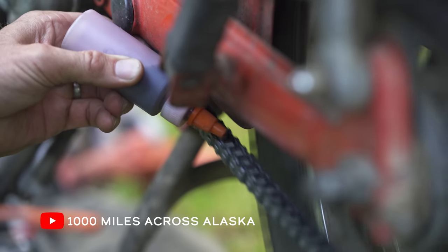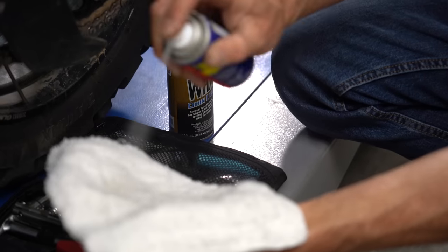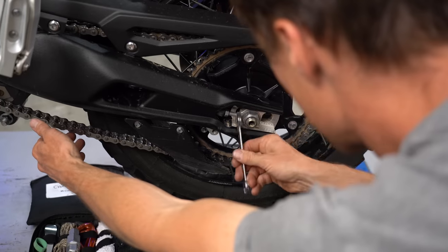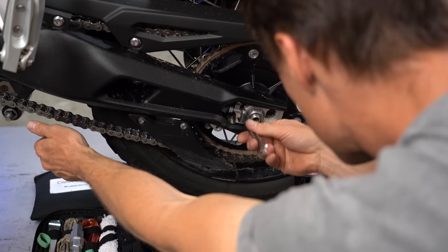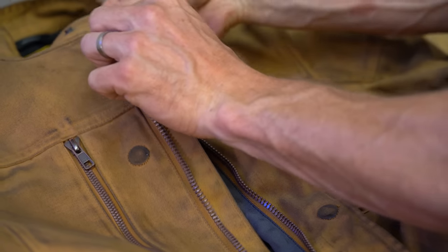If your bike has a drive shaft, good for you — you can skip this section. For the rest of you running a chain and sprockets, those parts will require some attention during an extended trip. I generally give the chain some TLC at the end of every day of a road trip, since it's easier to wipe off a little grime every day than to scrub off a ton of grime once a week. I just mist a rag with WD-40, use it to wipe down the chain, and then apply a little bit of lube. With modern o-ring chains, the most critical lube is already sealed inside the links. If I'm running a clip-type master link instead of a rivet link, I'll carry a spare. WD-40 is an effective solvent so it works well for cleaning stuff, and chain lube works well for lubing other things like lever pivots and cables. I also carry one of these small bottles of silicone lube — excellent for lubricating zippers on your luggage or jacket, and it works well for anything rubber, like forcing a carburetor or throttle body back into its rubber boot.